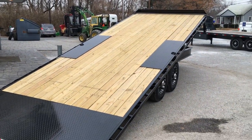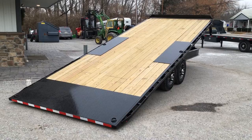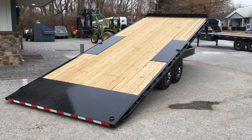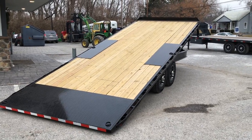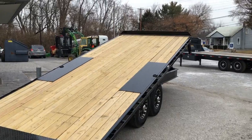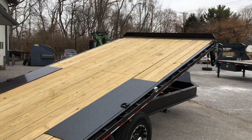New for 2018 — while it's not a manufacturer standard — we're going to start ordering ours with an oak deck. That goes hand-in-hand with getting better traction going up these trailers, which does seem to be an issue with some manufacturers. So we're going with an oak deck standard, and since a lot of our customers put winches on, we're going to go ahead and put a winch plate on all of ours — equipped for a winch should you choose to do so.